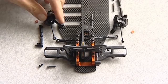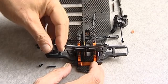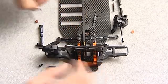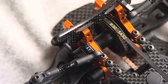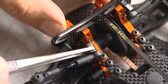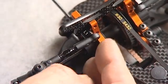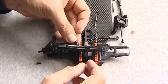We also redesigned the front steering blocks by cutting off more material, which allows a bigger steering angle when the car is turning. This gives the car more steering into corners and also better cornering speed. Additionally, we redesigned the roll center position — new, more inside roll center positions that provide more steering, more traction, and make the car easier to drive.